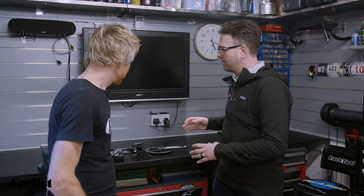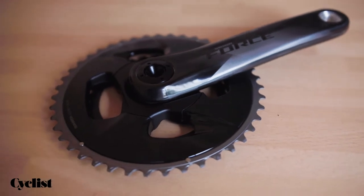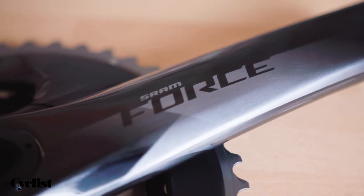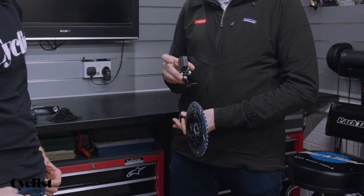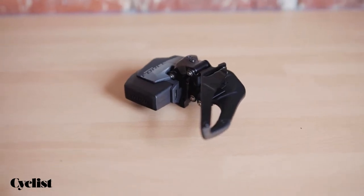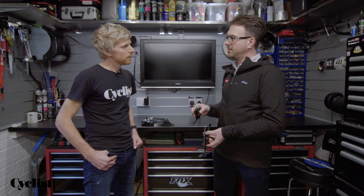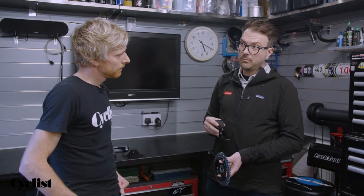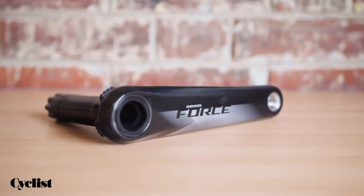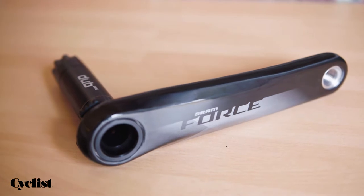So it comes in two parts, working from the front of the bike to the back. We've got a slightly lower gear range on the chainring set — a 43/30 chainring — and this has also got a slightly wider stance on where the chainring sits in comparison with the frame. That is to put the front derailleur slightly wider away from the rear tyre. As gravel bikes or all-road bikes get more popular, tyre size also goes up. It's not uncommon to see a 700x45c tyre on a gravel bike, and one of the issues you run into is that tyre sitting awfully close to the front derailleur. So what we've done is move the front derailleur outboard by 2.5mm — the overall spindle length on the crank is 5mm longer — moving the chainrings and the front derailleur 2.5mm further away from the centre of the frame, so you get a lot more clearance for the tyre.